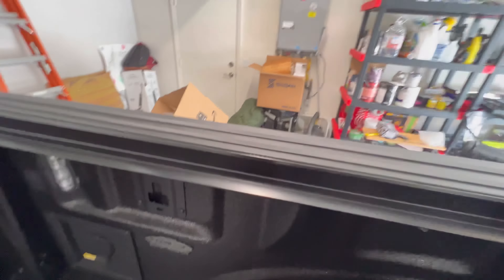I finished with the rails, but it took a little longer than expected — I had to get my wife to come out and help hold it. The area up front needs to be level, and you also have to put slight tension on the tailgate bumper. Every time I tightened the clamp near the tailgate and then lifted the other side, the first one would fall. Try to have someone hold one end while you tighten the other. Also, wherever you place a clamp on one side, try to mirror it on the other side so they're stabilized at the same positions.